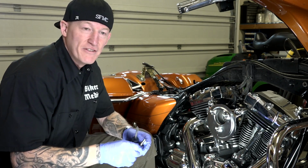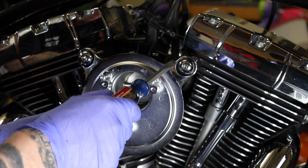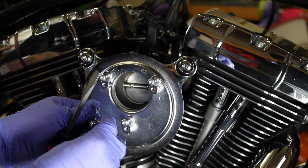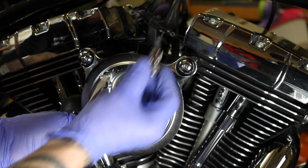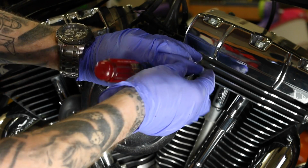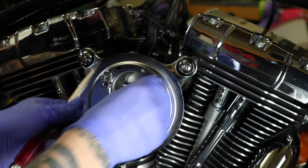All right, guys, real life. Again, these O-rings, I put them down in the channels behind those crank breather bolts, but they keep falling out, and you could actually get them in there wrong. And so all I've done is I've taken my 1/4 inch Allen, and as I screw it in, I'm just taking a little screwdriver and working that gasket up in there just to make sure that it's getting in the channel and it's not getting off and getting crushed the way it's not supposed to.